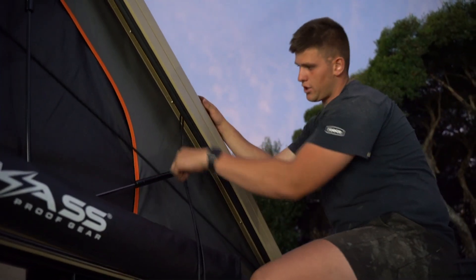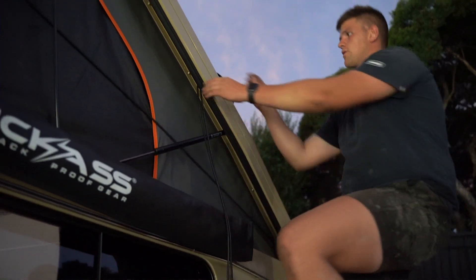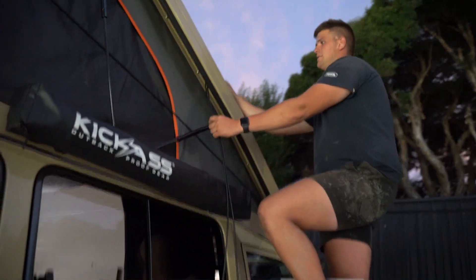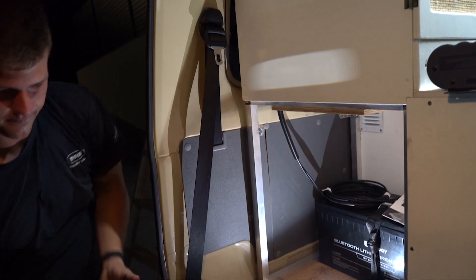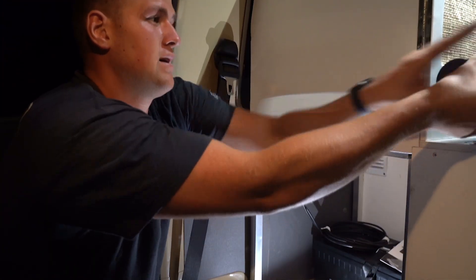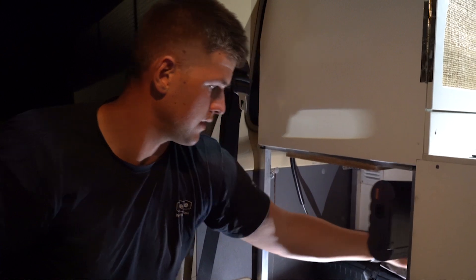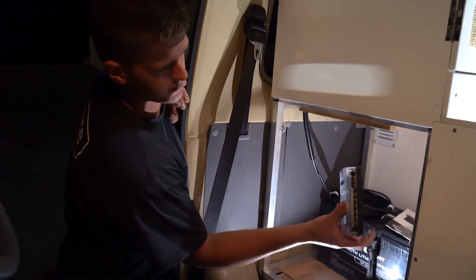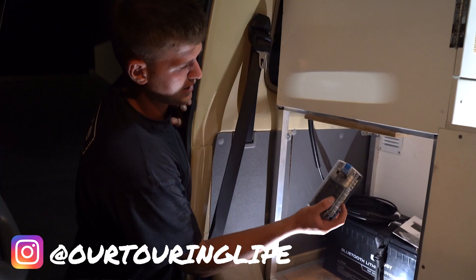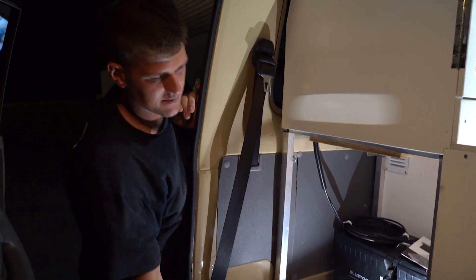It's hard to see but it's up here and then these are going to go in. A bit of split tube behind this, behind the gas shot, and then go into another grommet just here. Just putting in a piece of support timber. The inverter's going to sit there, probably somewhere there. And our Manager 30 is going to sit on the side here. We've got a Bantec fuse block on the side so everything can run through there - it's a 12-point fuse and earth block so everything can run in and out of that, apart from anything high current like 50 amps and 30 amps and above.